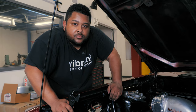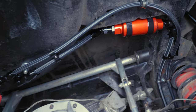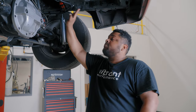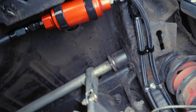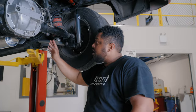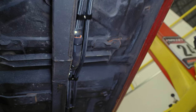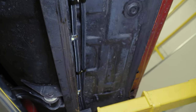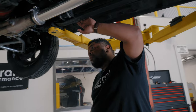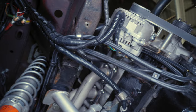We come out of the spare tire well where the fuel cell is mounted, with our dash 8 feed and dash 6 return using bulkheads. They run along the frame rail with our P-clamps into our fuel filter. I wanted it to be a little fancy and not use zip ties, so I used our stepped billet line separators. We come down the fuel rail, around from the exhaust to keep it away from the heat, through the floor, around the subframe connector, and along the frame rail. Again using our billet line separators, up and around the wheel well, tucked tight against the frame, looping up to our engine bay.